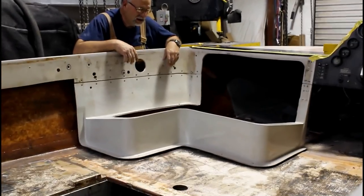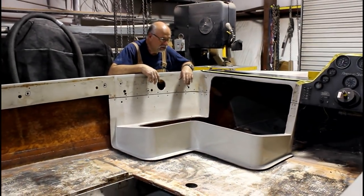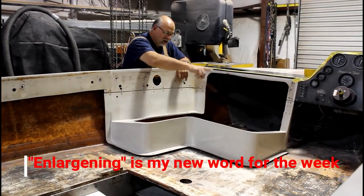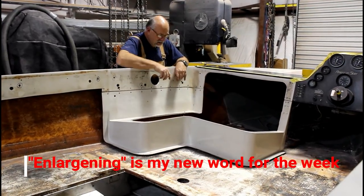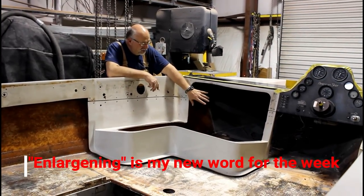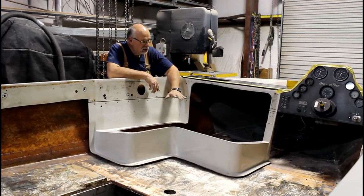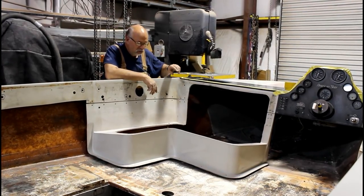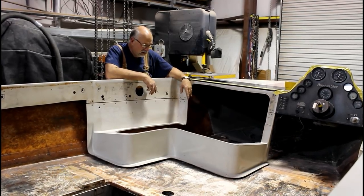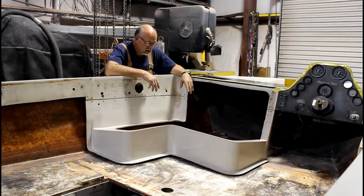So there you go, guys. That's how we do the L-seat removal, the reinstallation, and enlarging the access. Even a big old boy like me can now crawl up under the front. This is a huge access. The one-piece seat will hinge across the top. We'll put gas struts on it, and the whole thing will lift up. This is the way we did it starting around 2000.